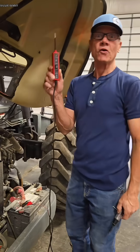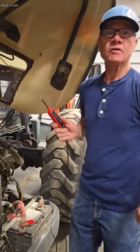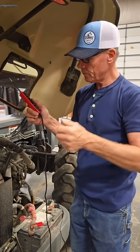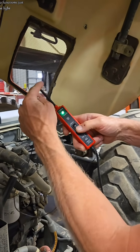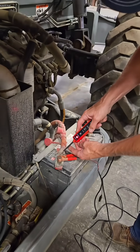Test light or circuit tester — you get so much more for your money with this circuit tester. This thing has a grounding lead for testing components, and this push button allows you to put positive out the end or negative. It also functions just like a test light.